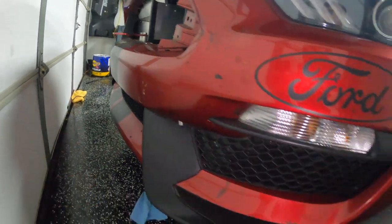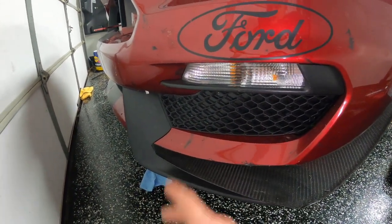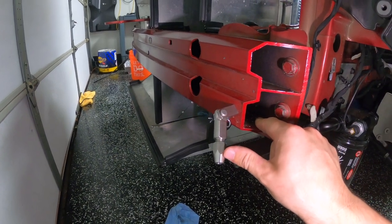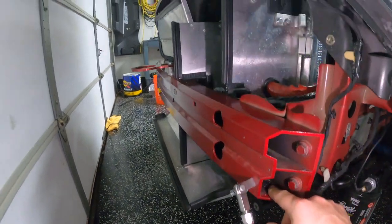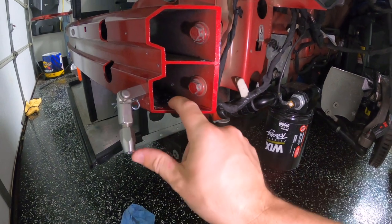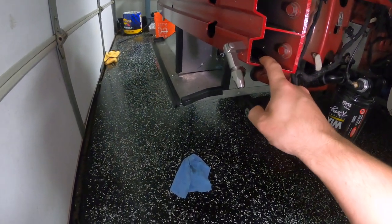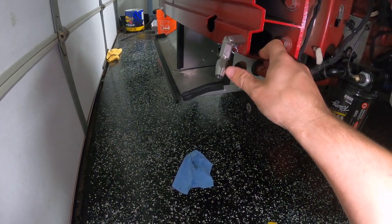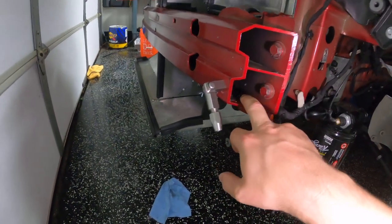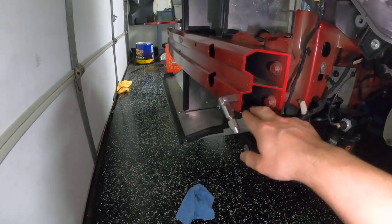I'm going to have the two rods in the front that I had before, and then due to the design of the splitter — how much it sticks out in the corner area — I'm going to create some rods that come out on the sides for stability. The most exterior ones go on an angle. I actually tried to mount them right there but the rod's mounting piece hung down too low and interacted with part of the bumper in a way I couldn't work around. Another option would be to build a custom bracket off the crash bar, which is probably the proper way to do it, but I don't have the ability to weld aluminum and this should not see enough load to be an issue.